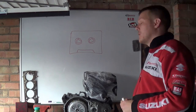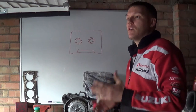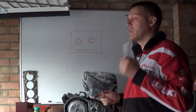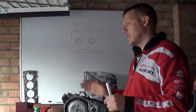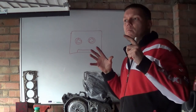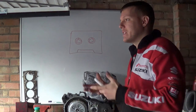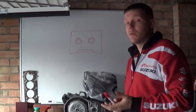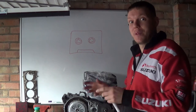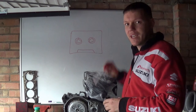Hi, my name's Matt. Welcome back to the shop. Today we are talking about cassette gearboxes versus a normal gearbox. A motorcycle gearbox is known as a sequential constant mesh gearbox with an input and an output shaft — none of this layshaft rubbish and no reverse unless you've got a Gold Wing. There is a difference between a cassette gearbox and a standard gearbox. One is more expensive and more complicated than the other, and that's the cassette gearbox.